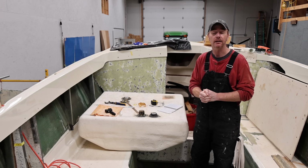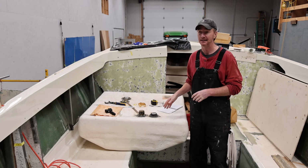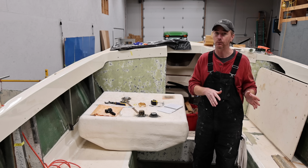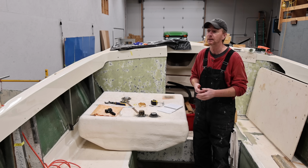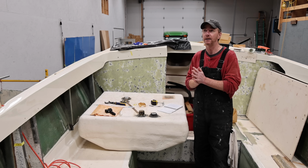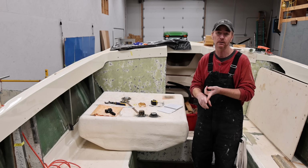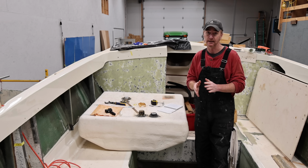The other question was, what is this tank made out of? This is a fiberglass tank. I'm going to touch more on this in a little bit because I know that traditionally the original fiberglass tanks did not play well with current fuel, specifically fuel that contains ethanol. The original tanks were built with polyester resin, and long story short, the ethanol would break down the resin and create a gummy mess inside the tank that got sucked up through the lines and followed up to your engines. It made a hell of a mess. But again, I'm gonna touch more on that in a little bit.